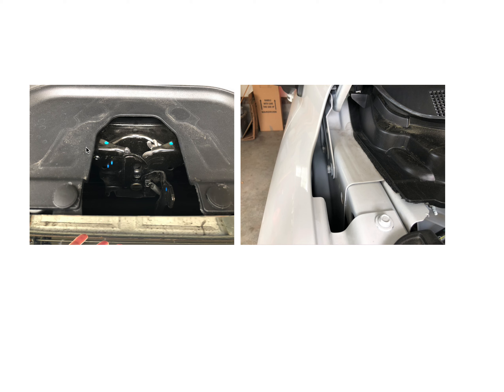First I moved the latch to the passenger side, thinking it needed more leverage to pull the hood down. What I found was that it did seal the hood tighter, but not what I was looking for — it was off a bit in terms of how it sealed at the top of the grille. So I moved the hood latch to the driver's side, and what that did was pull the hood tighter on the passenger side but lifted the hood on the driver's side where it sealed on the grille a little bit more. You have to play with this to get it just right.